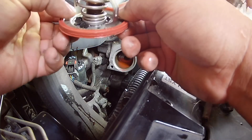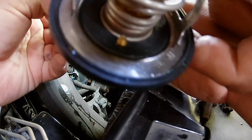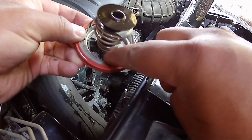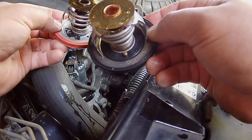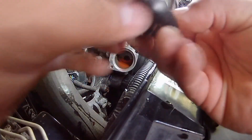There's a difference — you see in here, if you see the rubber piece in there? The rubber's all gone on that one. This whole lining right here where my finger is — this whole rubber piece is missing. P0128 basically means your thermostat is opening too soon. There's a pin right here that goes at the 12 o'clock position — it helps air escape.